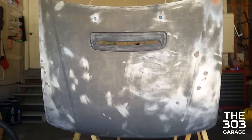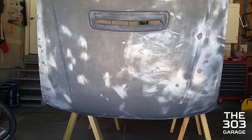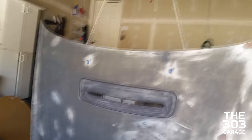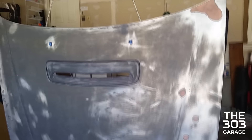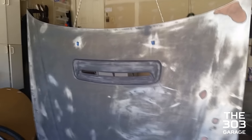Right now we're working on the hood. We sanded down everything, stripped it all of its paint, and bondoed all the corners. This area right here is really bent, and my dad managed to hammer it out and then bondo all the dents, so it actually turns out really well. I've got one coat of primer on it so far — I do a lot of light coats because it turns out a lot better. I got a little bit of overspray there but it didn't run, so we're fine.